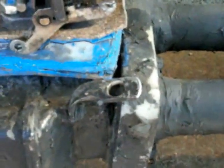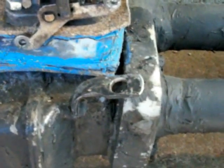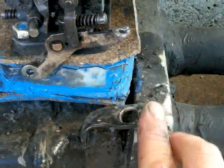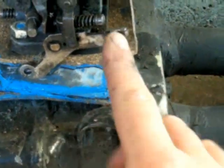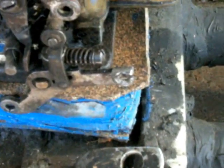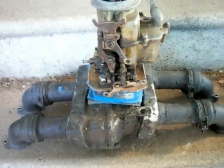Down here at the front, this is where the control cable actually comes in. It comes in from the bottom through this hole right here, and I use the lock nuts to keep it in place. Then I thread the actual cable and the barrel in through this little doohickey and smush them together. You'll notice that it's pretty worn. I may have to figure out a better way to do that, but it's been holding up for 10 years, so I ain't gonna complain too much.